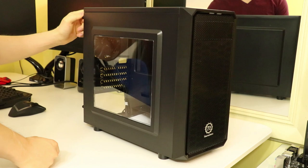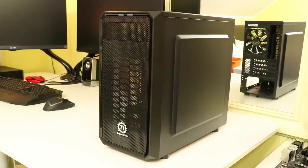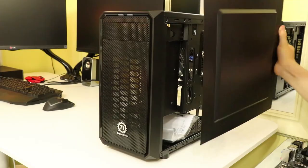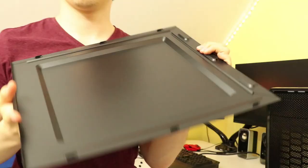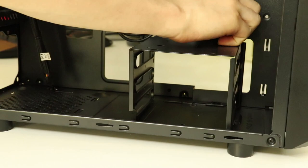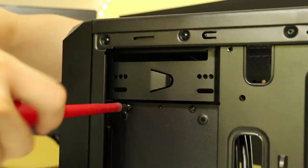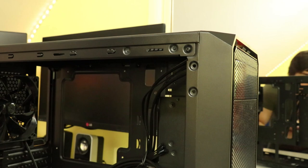To access the inside and provided screws and extras, we need to remove the two thumbscrews from the rear. The side panel has questionable rigidity but for the price point it does the job well enough. Removing the other side panel takes the removal of another two thumbscrews; however, this panel seems to have much stronger rigidity. Note that this case has a non-windowed version if panel rigidity is more important to you than the side window. We can strip the interior quite extensively by first removing the 3.5-inch drive cage, and then the top 5.25-inch drive cage by removing a total of six screws.